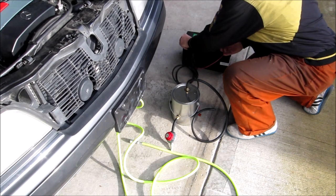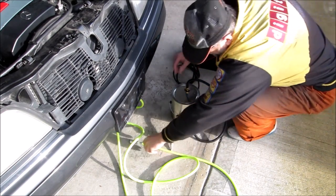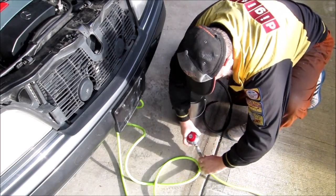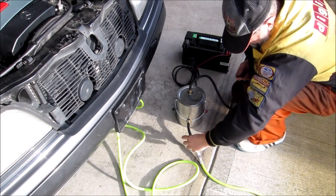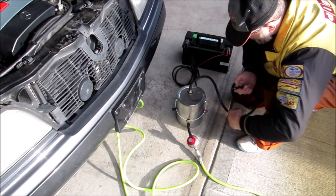The reason is because I was doing an intake leak test and I noticed that my EGR valve was leaking extensively around the stem. So here I'm just repeating the same test using the smoke machine.